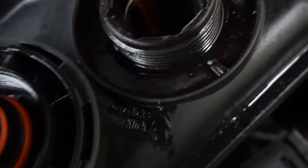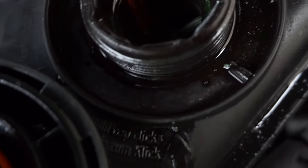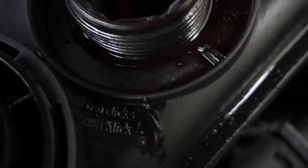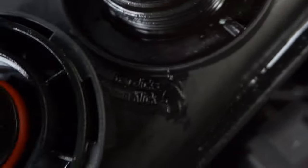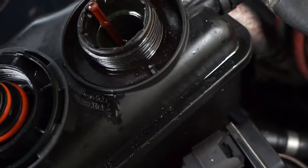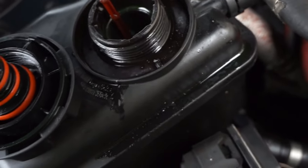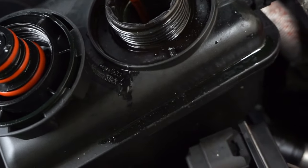The pump cycling on and off is normal. However, if yours is spurting every one to two seconds, that means your water pump is about to give out — be extremely careful, because once your engine starts heating up it's going to cause a lot of issues. Coolant won't be able to circulate properly through the system.